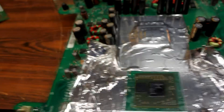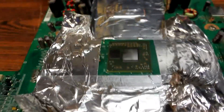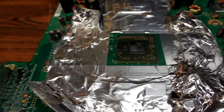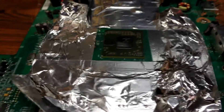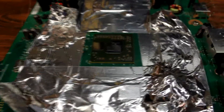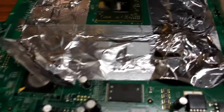E74 can be one of two things: either the ED RAM is bad on the chip and it's unrepairable — you have to replace the chip — or it can be a false positive for cold solder, a bridge, or something like that. I don't take the risk; I'm just going to lift the chip, throw it out, and put a new one down.